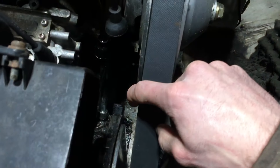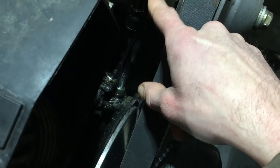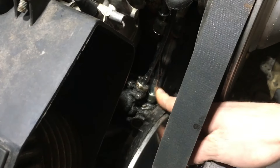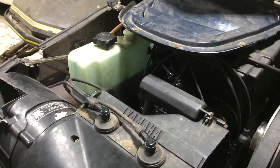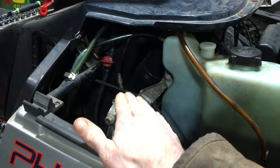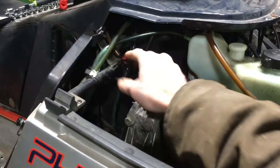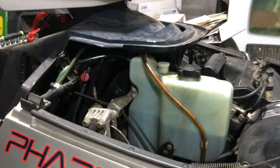If we look down here, you can see there's some shininess going on — it's not usually there. I just took the liberty of pulling these little boots up and around my tachometer cable, and it's nice and wet. So that tells me there's a little seal in there that probably just went bad. I guess we're going to be wrenching on that today along with trying to locate the fuel leak. I know the leak is not in the tank; it's somewhere out here. I do have new fuel lines — those were put on like two years ago — so let's try and fire it up and see where we can find it leaking from.